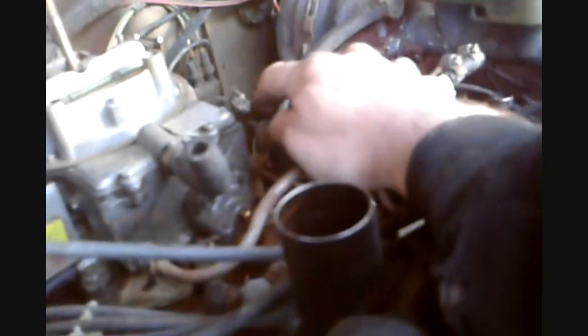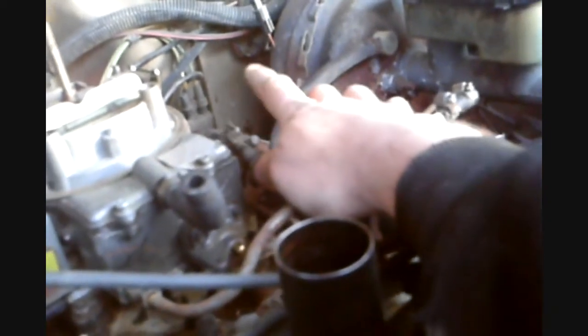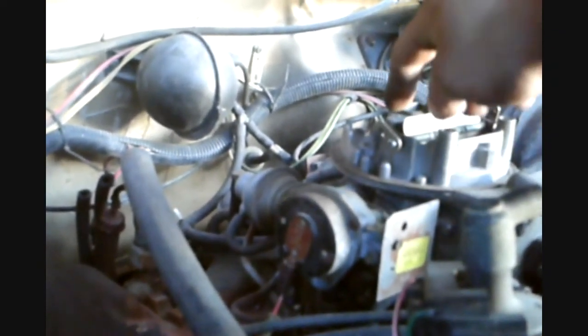The electrical to the carburetor — I haven't confirmed it's working yet. I haven't turned on the heat to see if it kicks up the idle a little bit. If it doesn't work, I'm going to get rid of it. This opens up the choke as soon as it starts so it doesn't flood out — that's working good. And that's the hot air that goes into the coil for the choke system. Even though it's electrical, I guess they need that too.